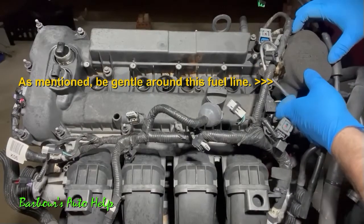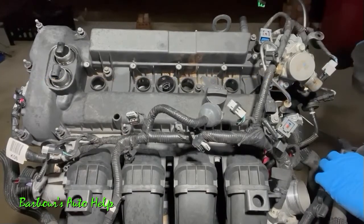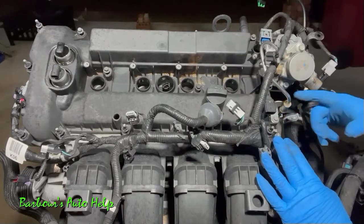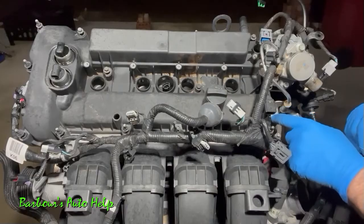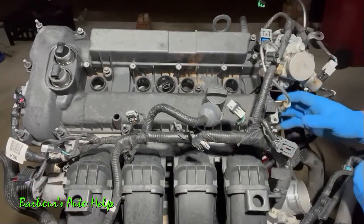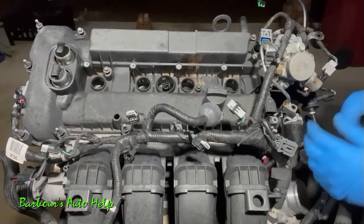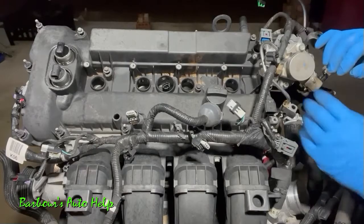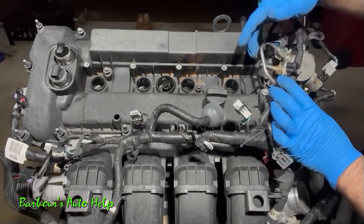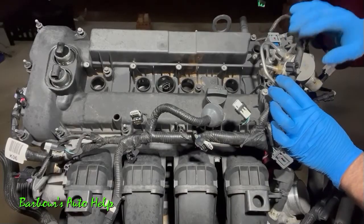It may help to remove the sound shield off the high pressure fuel pump to access that bolt more easily. On the back there is also a bolt that holds a bracket attached to the fuel line — take that bolt out and the bracket just spins out of the way. You don't have to take any lines off. The low pressure fuel delivery line on this nipple here doesn't need to be removed either — you can work around it.